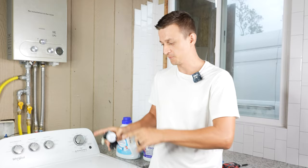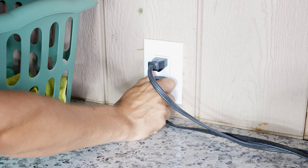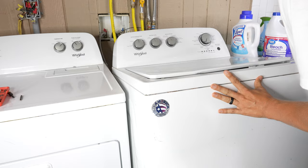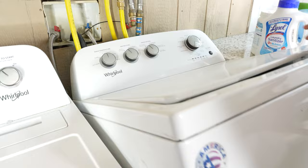So I'm going to go ahead and show you where to find it and how to replace it. Before we take anything apart, make sure to turn the power off. The first thing we're going to do is pull the washer out and tip it back. While you're tipping it, go ahead and look behind it, make sure none of the hoses are getting kinked and the drain line is not getting pinched somewhere. If it's not, just lean it back all the way so that the washer is standing by itself, or you can prop it on the bottom with a paint bucket or something.